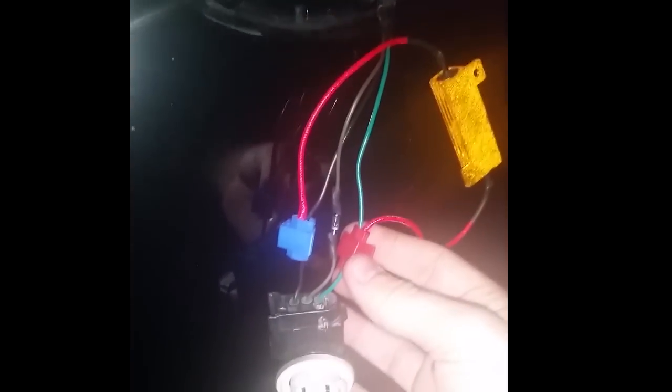We've got our fully wired and put-together one. We've got our 50 watt 6 ohm resistor. Splice into your far right wire — it'll be green, or on the other side it's yellow. This is for the right side. Then splice into the black negative. Now this middle wire — I soldered this in. It's good to do that. You can just wrap it on, crimp it on, and tape it, but why risk it coming apart? Just do it right the first time. Soldered this in. Remember, you want that silver line — that's the polarized tip of the diode — facing your lights.